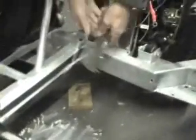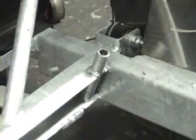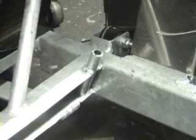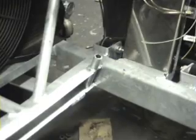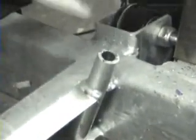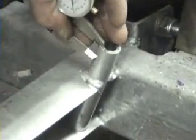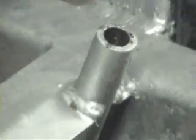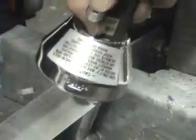Check this one as well in case it's different — again, 11mm off. We'll mark it and then cut it off with a hacksaw.